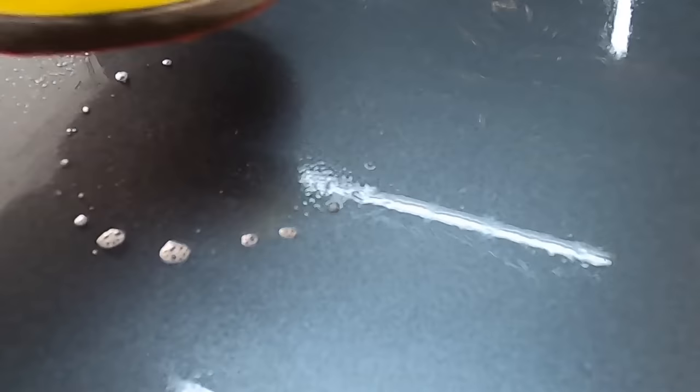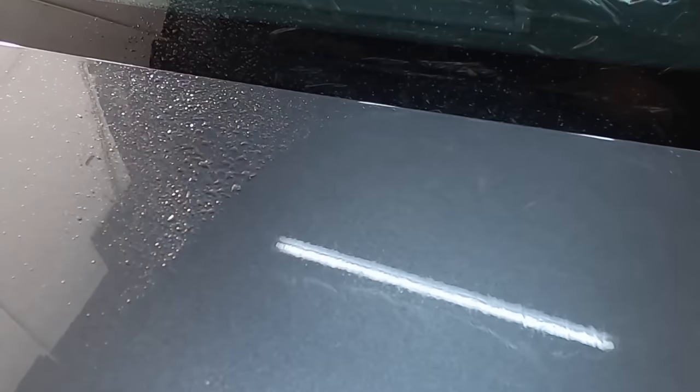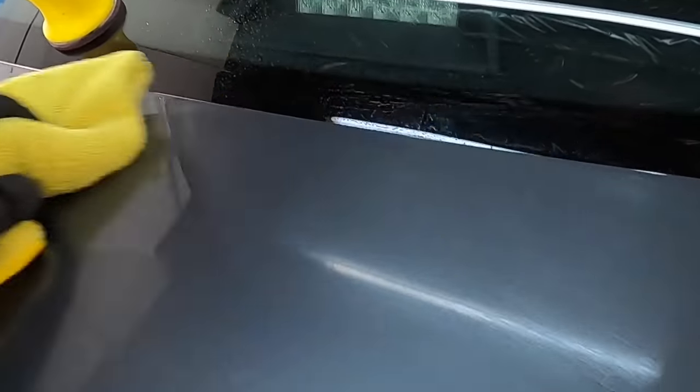First, we have some staining and etching, and we'll use 3000 grit, and that's just attached to a simple palm sander, and that's the best way to start to learn wet sanding. Doing it by hand, you definitely get the feel for it. You get a feel for what you're doing. You let the surface respond to your touch, and you can easily remove a lot of imperfections using this method.